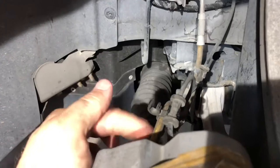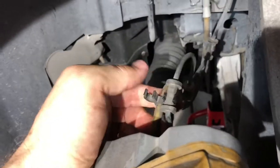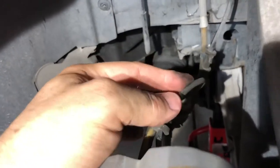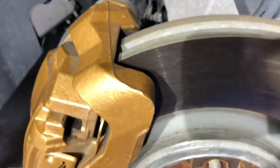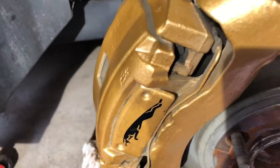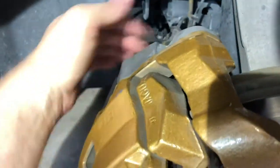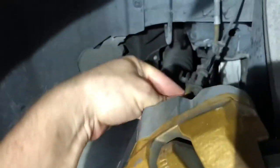So I'm sticking with the stock one. I realized it was steel braided brake line too, so it's nice. We just attach it to the back side and use the same screw. This line here I believe is for the anti-lock system, so that can just pop off and out of the way. To remove the caliper, there's just two big bolts on the back side - they're 15 millimeter. Break those loose with a hammer; they're pretty tight on there, and then this whole assembly can pull out.